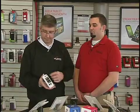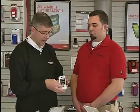The first one, the simplest thing to do is just let people leave their phone turned on, plug it into the charger — it might not turn on or it might freeze up. A lot of times you can just pull the battery out of it, leave it out for just a couple of seconds, put it back in, turn the phone back on, and that will overcome some of those issues.